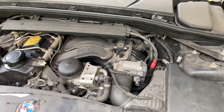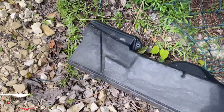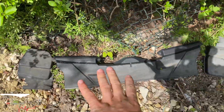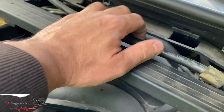Undo the air filter, take it out and pull it to the side. I highly recommend removing this first because it's easier to get in after. Undo these four bolts and this comes off. Take both sides of these off — you can see a screw there and another one on the other side. Unhook both sides, then lift it carefully, and take this off as well.